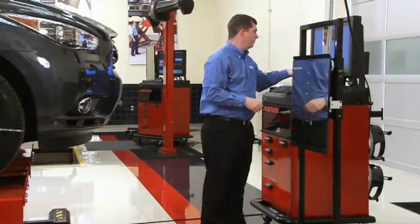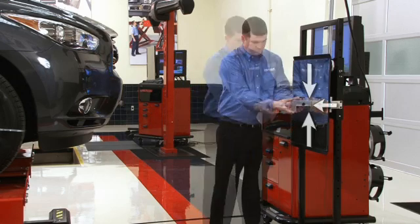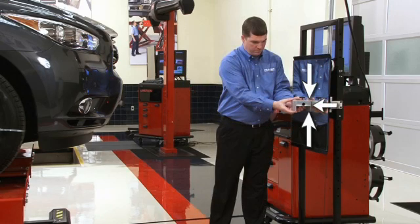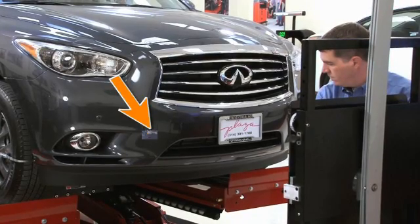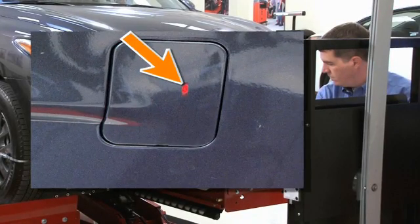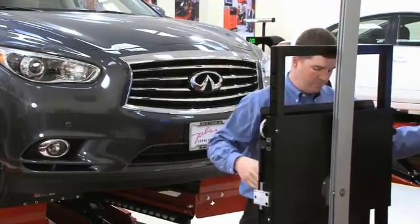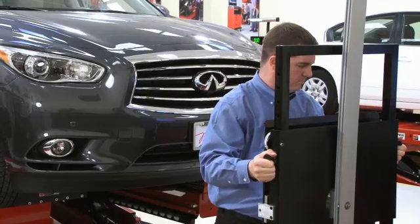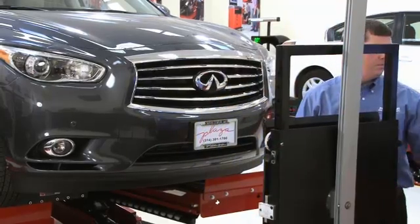To check the height of the mirror, turn on the laser assembly and place it against the center area of the mirror. Then note the position of the laser dot on the bumper. This location indicates the mirror assembly is too high. While supporting the weight of the mirror, pull the height knobs out and lower the mirror one position at a time. Recheck height with the laser assembly.